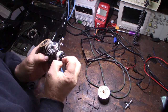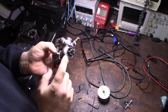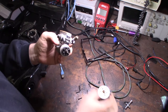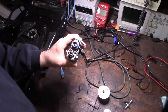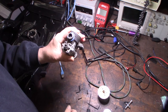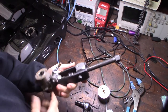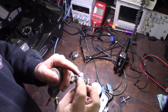What's interesting is the clutch material has a groove in it - I've never seen a clutch like that before. It feels like some sort of synthetic material, not metallic. I don't think this flywheel is going to be big enough for my bump box, so hopefully I can get a bigger flywheel on there that will clear the carb. I also don't like these pull starts because they create a lot of drag. I use a car power steering puller - it seems to be perfect for removing flywheels.